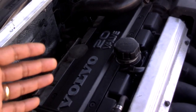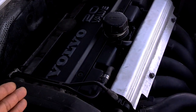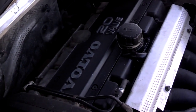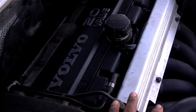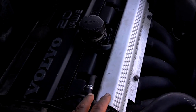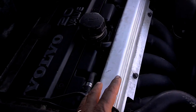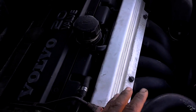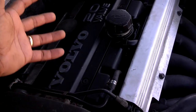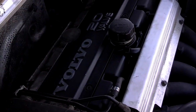Your injectors are still spraying fuel or water, whatever, into the combustion chamber. But if you crank your car, that fuel or water contaminated that may still be in the actual injectors will pump that fuel that you've now got in your fuel line, your 100% fuel, through those injectors. And as you crank the car, the water, fuel, or whatever will be coming out of your cylinder holes.